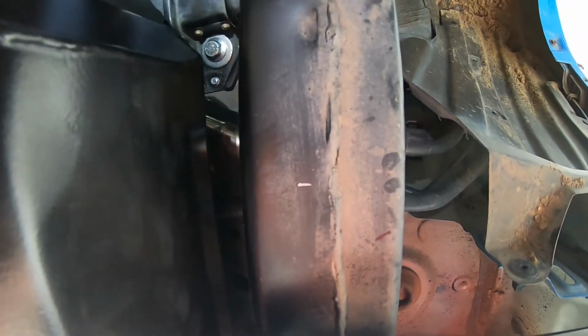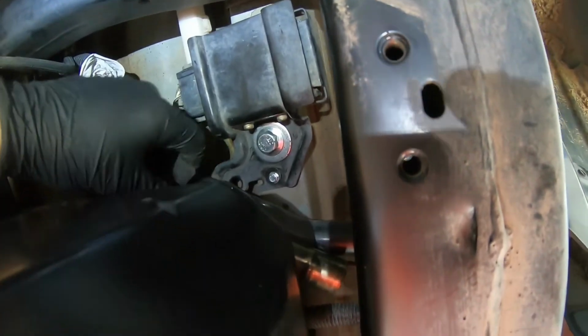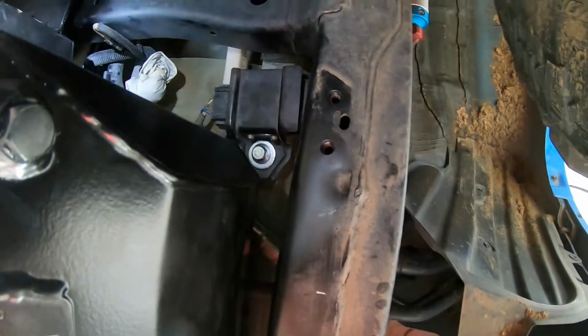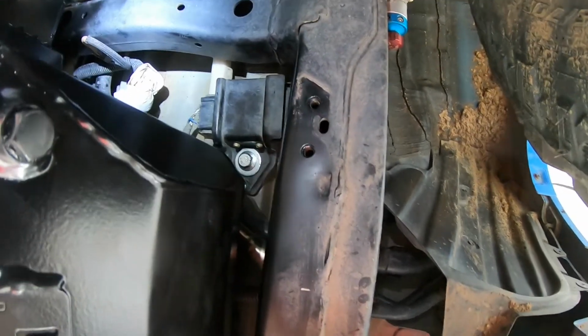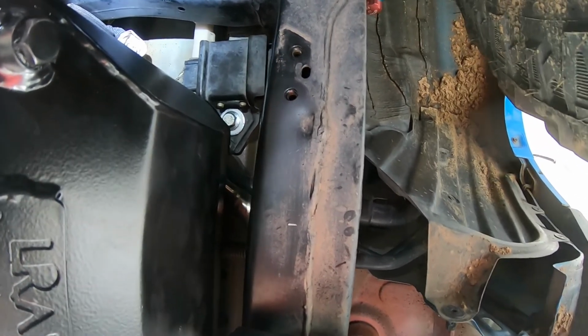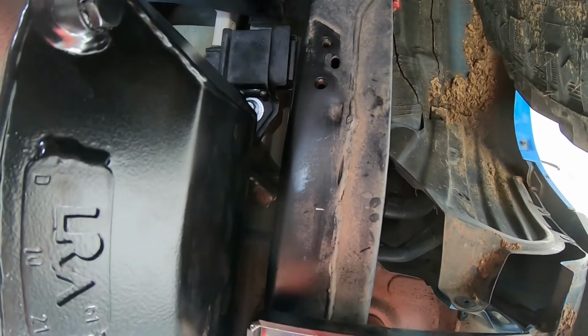You can see at some point too, I was wiggling it, right here. It really doesn't move much off of that hose connection to the tank, so you really got to match this up well. But during the testing phase, you just take a marker and mark where that T fits up in there, and that'll give you an idea of where you'd expect that T to land. Then your goal when cutting is to cut it so that you can place that T exactly where it landed during test fitting.